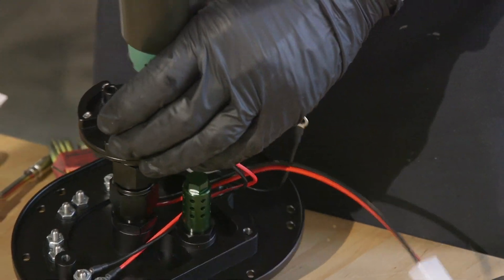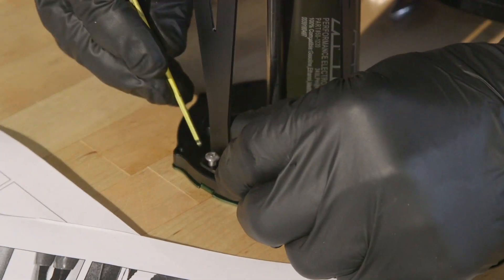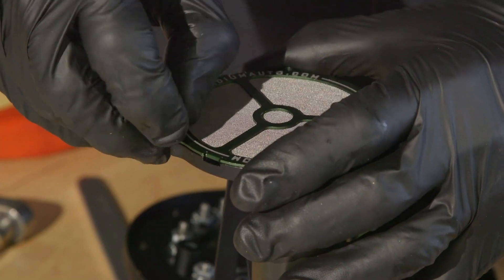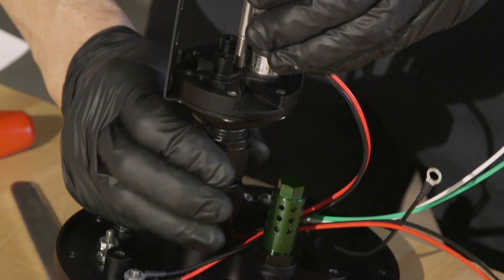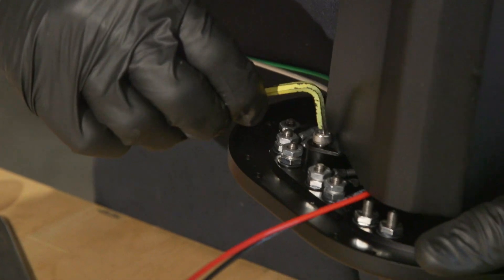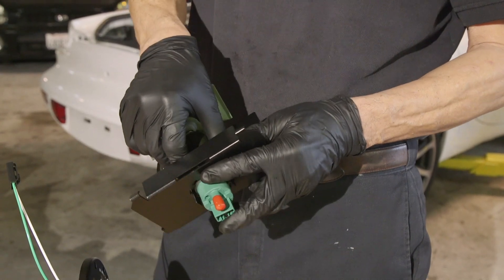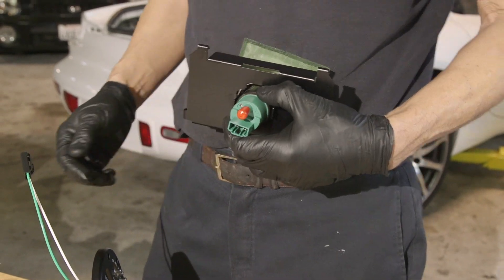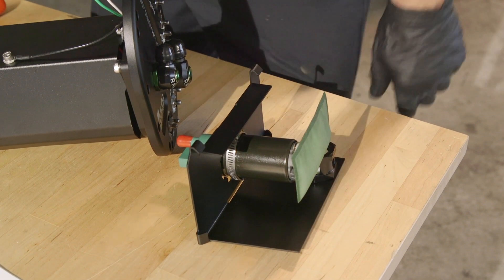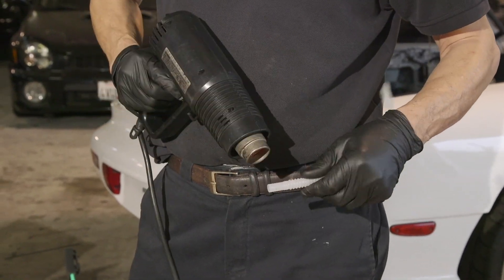We're going to attach the pigtail harness for the lift pump to the top plate at this time as well. Now we assemble the fuel pump hanger assembly and the pickup — the pump suction side is attached to the pickup base, which is held to the pump block by three brackets. When assembled, the pickup screen is attached to the pickup base and the pump block is attached to the top plate. The surge tank is then reattached to the top plate with the fuel pump in place. Next, the AEM lift pump is prepared by attaching the pickup screen to the pump inlet. The lift pump is positioned in the fuel tank baffle, held with hose clamps. Move the pump up and down to get the lift pump pickup screen even with the bottom of the baffle, then tighten down the clamps. Install the fuel transfer hose to the lift pump — if the fit is very tight, a heat gun can be used to soften the hose so you can slip it over the fuel pump barb.